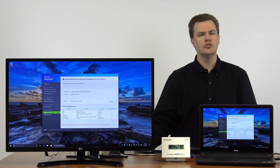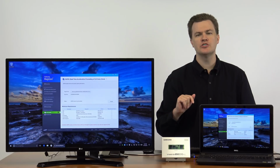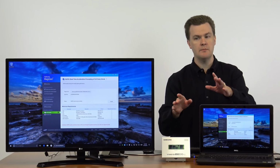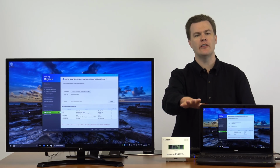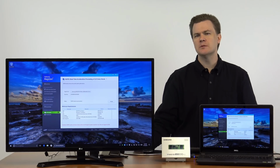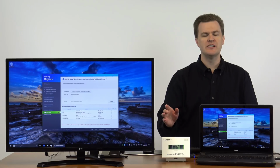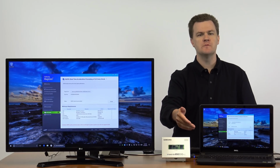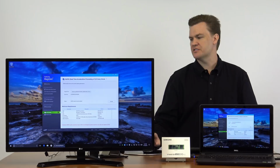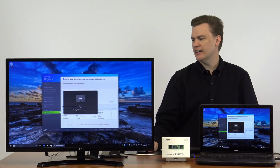On Crucial drives, for example, if you don't buy an 850 EVO and decide to get a Crucial MX300, which I recommend, I have one of those, I'll do a video on another computer showing it. They call it momentum cache, I think. What this does is essentially speed up reads and writes by using your extra computer's memory as a better buffer than Windows does. We'll hit Enable. Your computer must be restarted, yes.